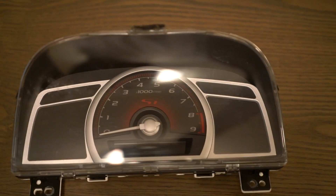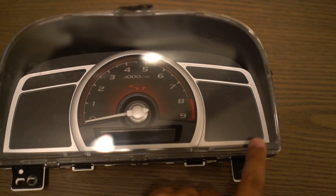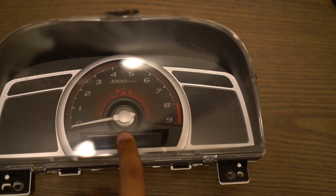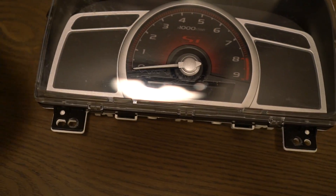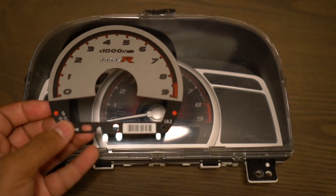What I'm going to be doing today is change the cluster — I'm going to change the overlay on it. Instead of the stock sides, it's going to be like a Type R look, so it's not going to glow. It's just going to have the numbers in white and a silver face. I got the cluster out, now I just have to take out the plastic bezel and the inside, then take the needle out to be able to add this overlay, which is a Type R one.